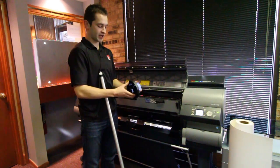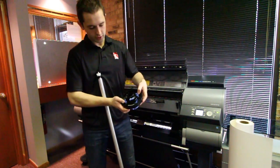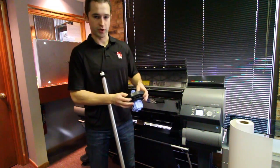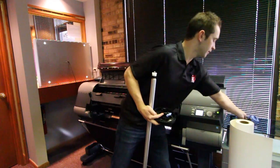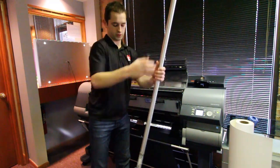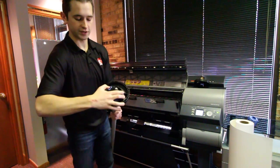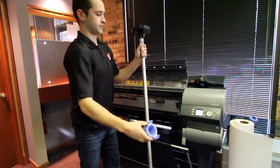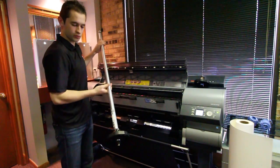I can be printing on a 2-inch core size roll. In order to get this out, there are two blue flaps on the side here. If you press in on them and press all the way through, they pop right out. So you do that for this side as well as the other side. If you flip over the spindle, it's the same sort of setup — press these two in and slide this all the way out. And your spindle is ready for a 2-inch core now.